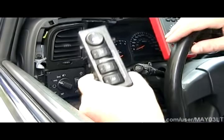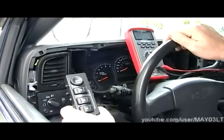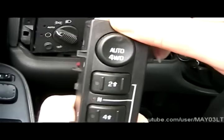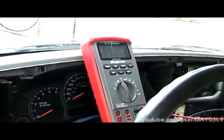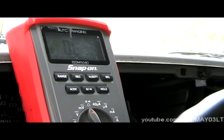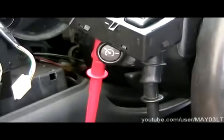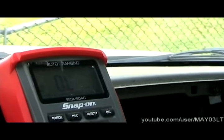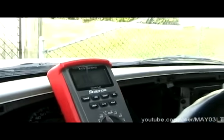We really didn't even need a scan tool to test it. Now what we could do is just watch this, or even just plug it in and walk away and come back — most of the time it will start fluctuating. And it might even be that if you jostle the switch a little bit from normal driving, going over bumps, that can also throw it off. We were just sitting here for a minute and then the whole circuit went open. I've got the switch resting on the stock, meter still hooked up at ohms, and it just went to open circuit on its own. So I'm replacing the switch — it shouldn't do that. As long as nothing's pressed down on the switch, it should always read between 8.6 and 9.5 kilo ohms. Always. If not, there's a problem with the switch itself.